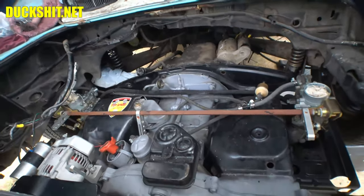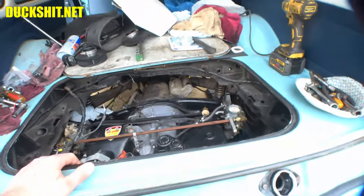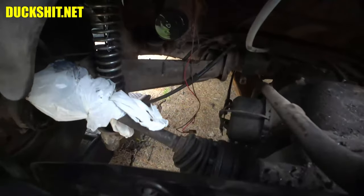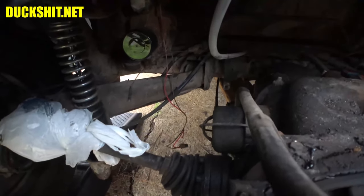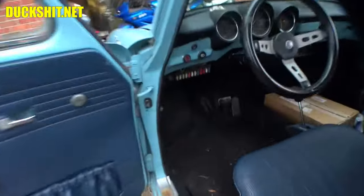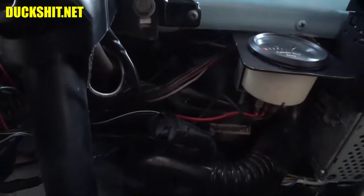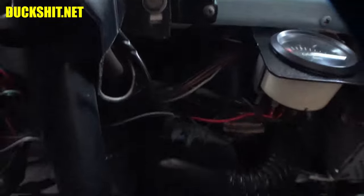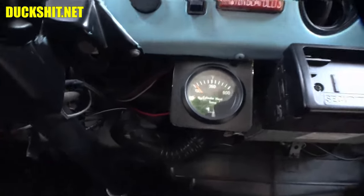Let's get this engine back lifted into position and see if we can get some bolts in. I want to make some big progress today. There's also that red and black wire — it does appear to be the cylinder head temperature sender wire. The reason I say that is it's close to cylinder number three, and when I looked at the gauge, the wiring on it happens to be black and red. I can continuity test it and probably will, but we need to get a sender for this thing and make sure it gets hooked up. I don't even know if it works without a sender.